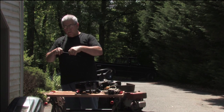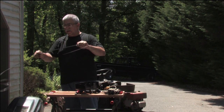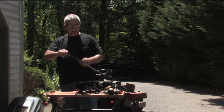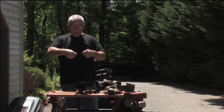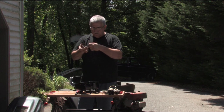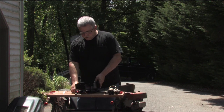Okay, so we've got the spring out. What we're going to do is just kind of turn it backwards and pull it through our fingers, putting a little tension back into it so when it coils up it's got the proper tension. So we've got the spring as straightened out as we're going to get it — it doesn't have to be flat straight. Set that aside.